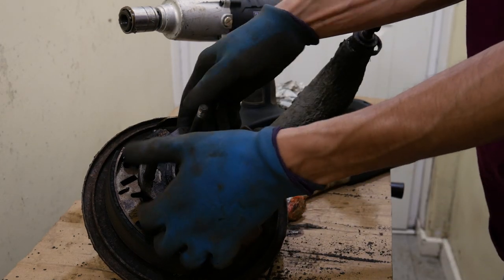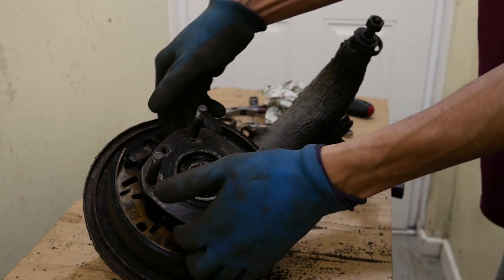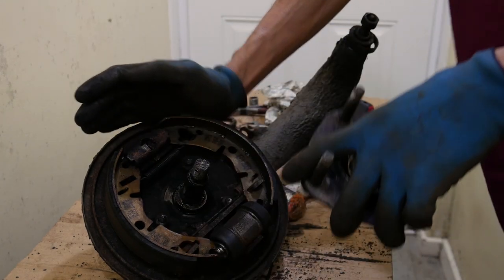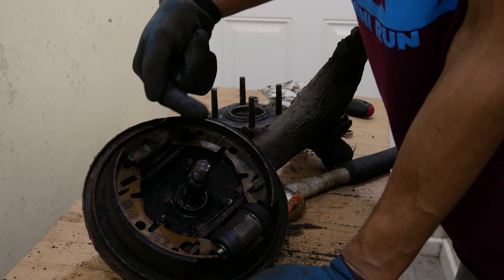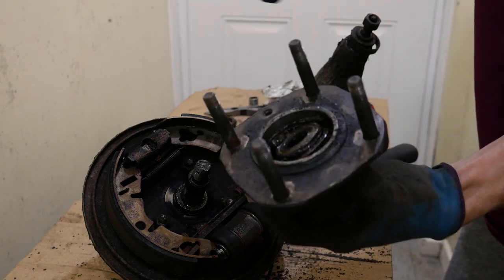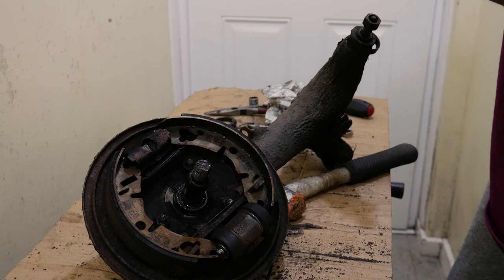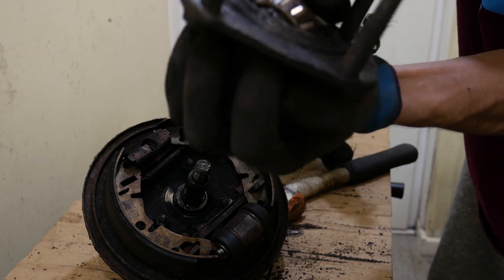When you come to taking this off, it always happens to me — they always get stuck on the spindle. This one's come out perfect though. The other hub I did got stuck, and the only way I could get them apart was chiselling between the body and popping it out. So that's the hub off. It stinks — I think this one's actually run dry at some point and overheated, gone quite black on some of the runners.